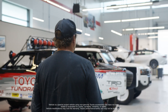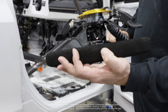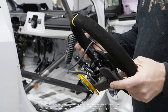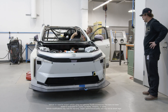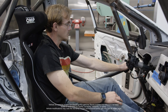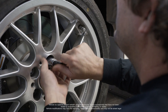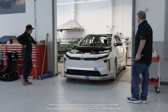Today we're hoping to get the steering wheel finalized. Marty and OMP basically came up with this steering wheel — Marty made a bracket for the regenerative braking so you're able to change how much or how little it drags. Today we're going to find out whether the wheels spin; we have not done that yet. So it's either going to be exciting or a head scratcher. We have to physically drive the car to make sure it's aligned right and the steering wheel is where it needs to be, then we'll tack our parts on and go from there.